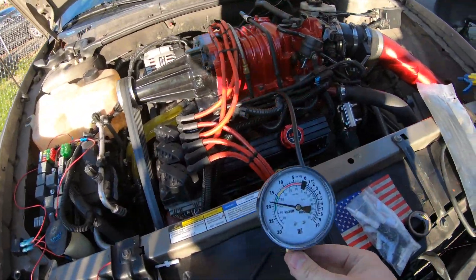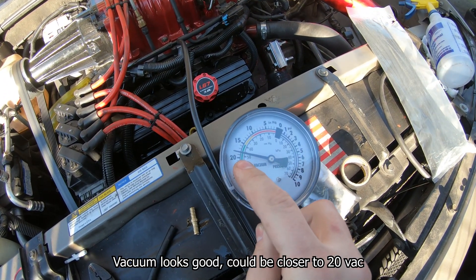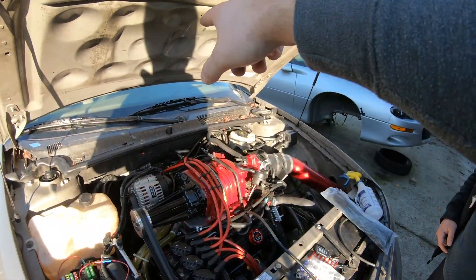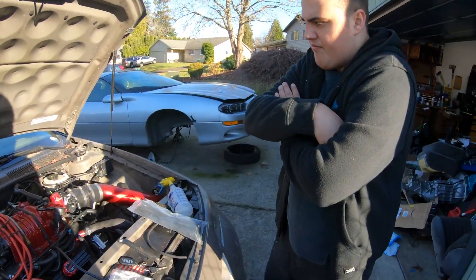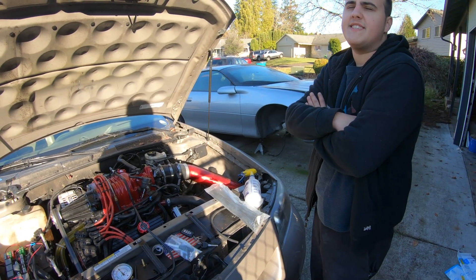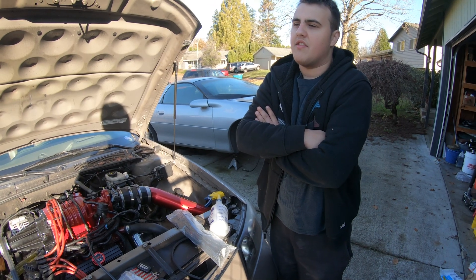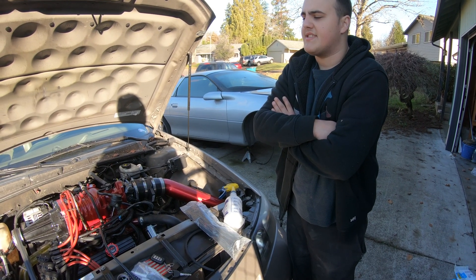It almost seemed like it covered a little bit without the MAP sensor in. Yeah, it seems like it's making good vacuum — it's right in the green. So we removed the MAP sensor, cleaned it out, put some compressed air and electrical connector cleaner in. Clearly it's not reading correct on the gauge, which it could have just been a dummy thing from the beginning. But it could also be worth it just to replace it because it sounds like it's responsible for some of the PCM boost airflow operation. However, it's always been kind of wonky on the vacuum side, but on the boost side it's been pretty accurate.